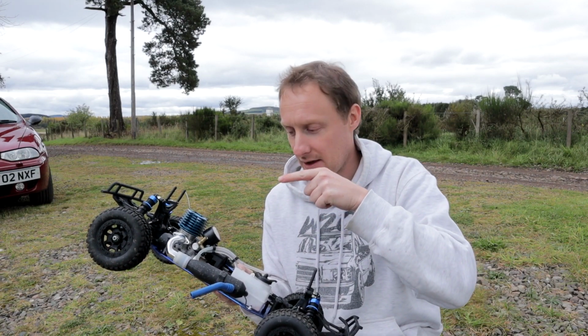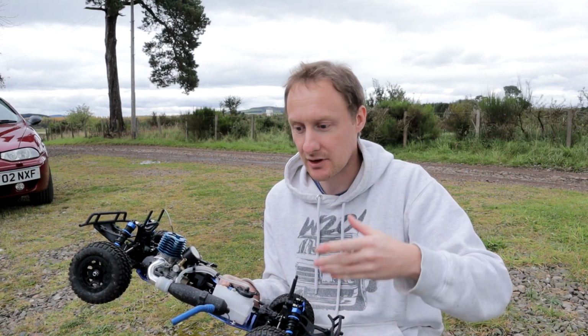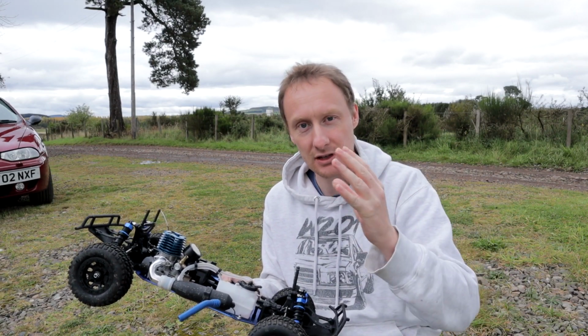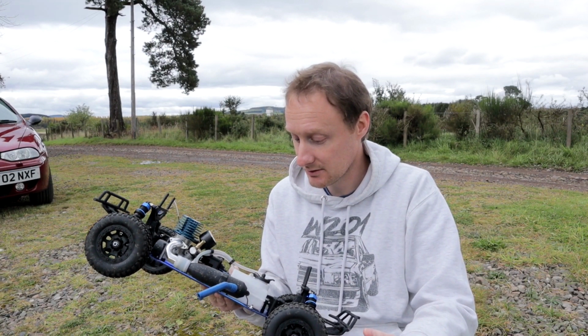even though it's not through the run-in phase yet, it's still early in the run-in phase. I still have to do another tank at quarter, then a couple of tanks at half, then a couple of tanks at almost full, then maybe a couple of tanks at full and off and full and off, whatever. I'm going to do it very gradually and make sure I get it right. But already it sounds a lot sweeter than that HPI one did, and that suggests to me that the HPI one wasn't treated very well from the word go. So yeah, I'm actually quite impressed so far.